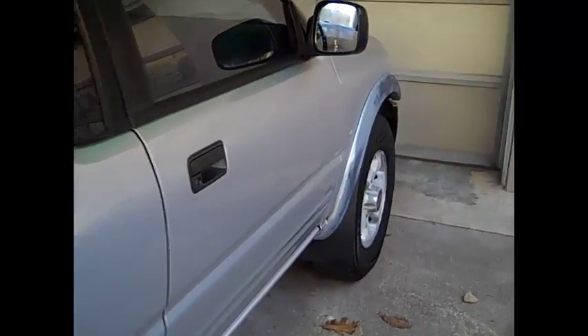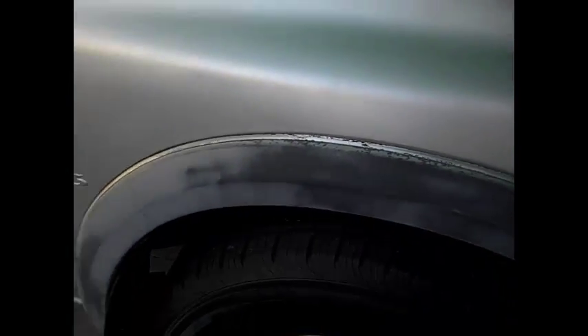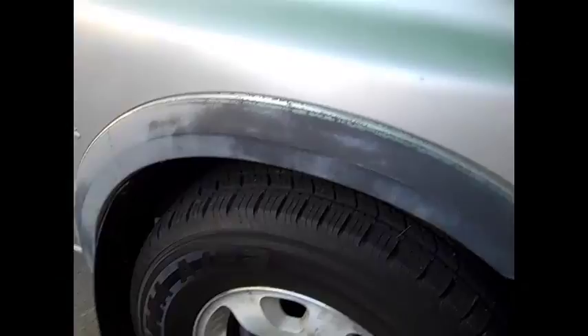Today we've got a little '99 Isuzu Amigo and somebody tried to do a spray can repair on the fender. You can see that's glossy — their idea of glossy is not really glossy — but this is flat and it even sounds like sandpaper. They sprayed spray can paint over the trim, because the trim is supposed to look like that, and there's a little crack in it right here. So today I'm going to repair the crack, sand that silver out, sand that flare out, and then repaint it.